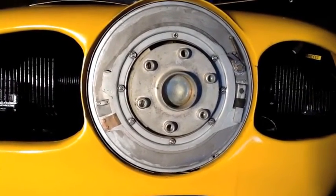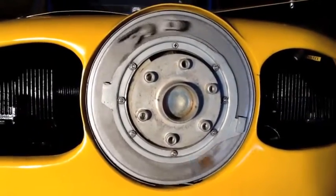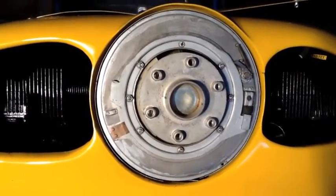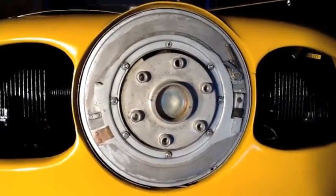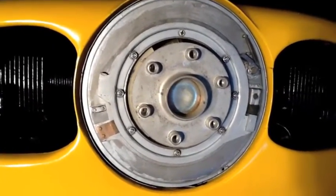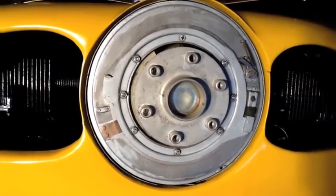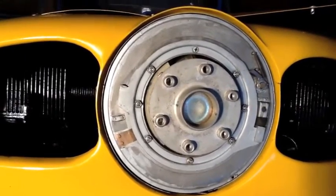We will now check the operation of the starter to make sure that there is full recoil. That looks good. If the starter does stick at any stage, the first thing to do is check that one of the mountings is not over-tightened. The best thing is to start with one nut, loosen it, check if there is full recoil, and then if needs be, a very thin packing washer can be put under the starter at that site.